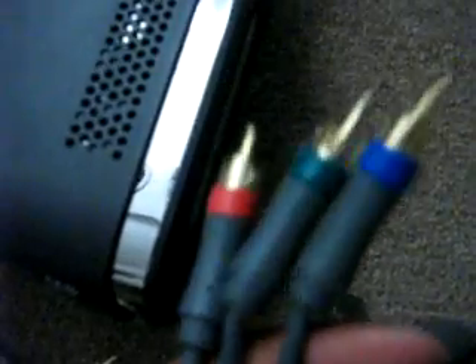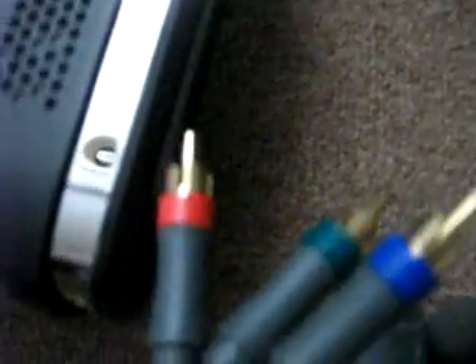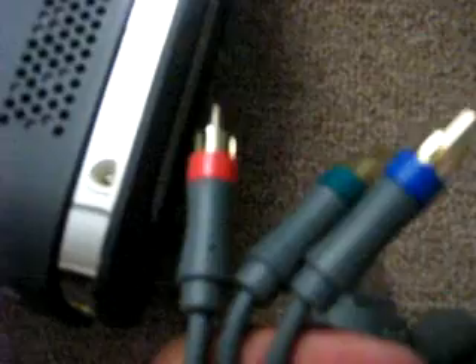Through the component cables, many people have been asking what kind of video resolution you get. You'll get standard definition resolution if you only have component inputs on your TV but it doesn't support HDTV. If you have an HDTV, it can support 480p (progressive scan), 480i (interlaced), 720p, 1080i, and 1080p upscaled — basically. It doesn't provide full native 1080p.